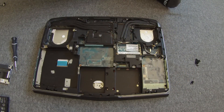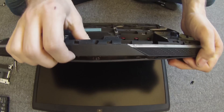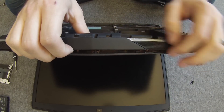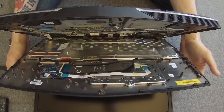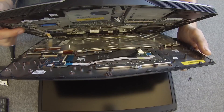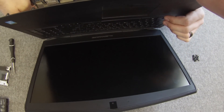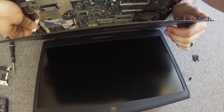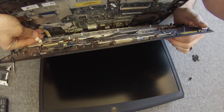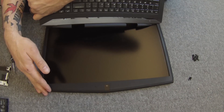After you have finished removing all of those screws, use this part of the laptop to push. Just like that, the top part comes off from the bottom part — just keep pushing and there you go. Now, this is the card reader cable over here. I recommend getting it from the top because it's easier — just pull the connector up, pull the cable out, and it's glued down so you can remove that glue. Removing the top lid is very simple, and then the top lid comes off just like that.